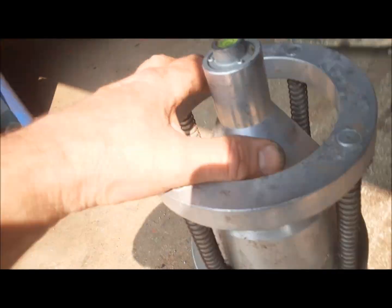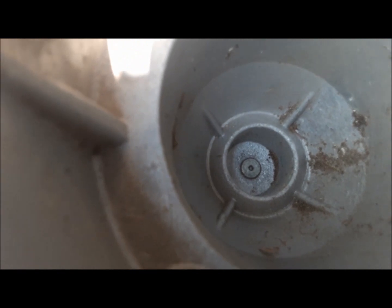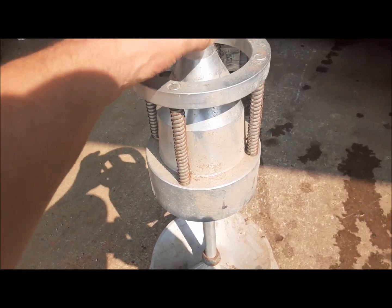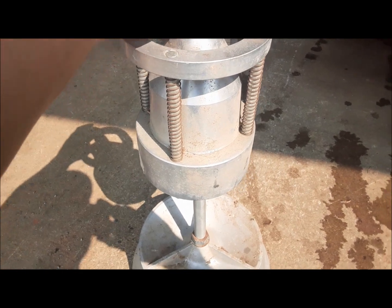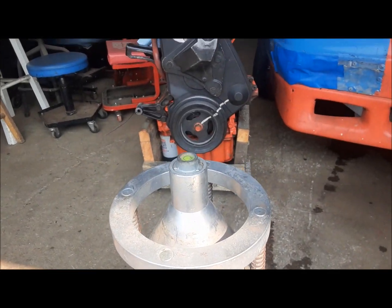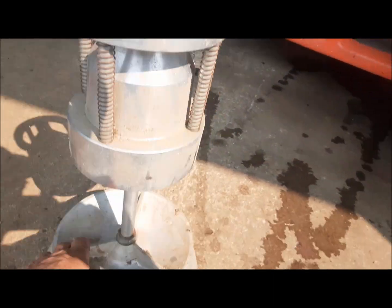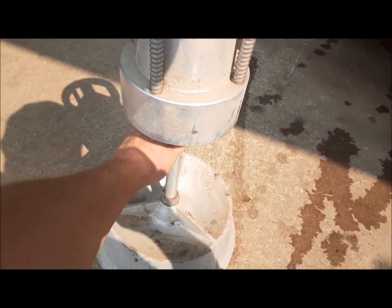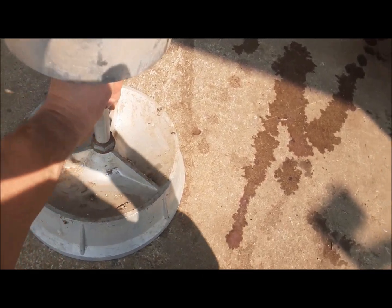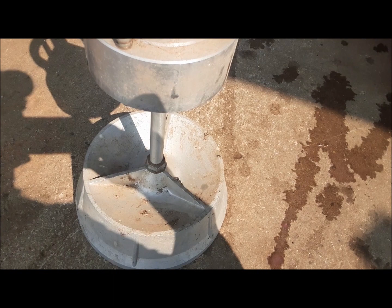How this thing works: it's got a hardened steel pin with a point on it, which runs in its seat down there — that's what makes Nomad self-leveling. You can put it on any kind of floor and it'll always find level on its own. It just has to be on something solid so it's not rocking and wobbling. I've got to tighten that — it's not helping us.